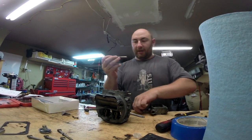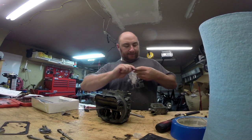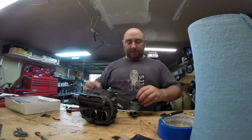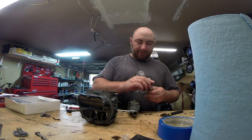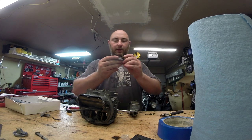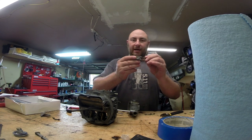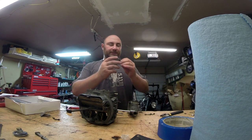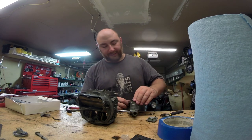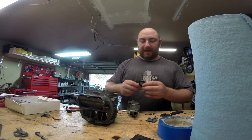Next you want to remove the crossover rod and on both ends remove the little black rubber nipples — the kit comes with a new set of rubber nipples. Next we take the accelerator pump cover off. One of the popular modifications people make is you can replace this arm if you need a better shot or less of a shot from your accelerator — you can replace this arm pretty easily. I'm going to leave it the way it is because I don't see any reason to replace mine, but a lot of people do.